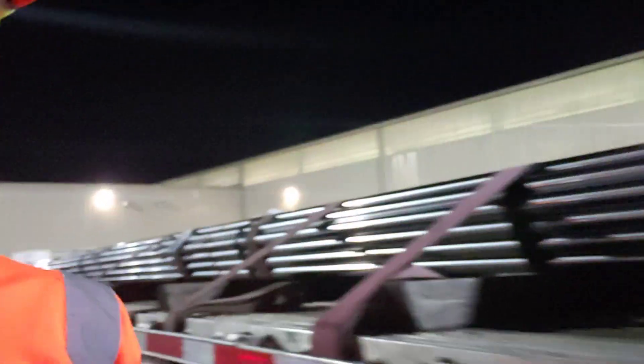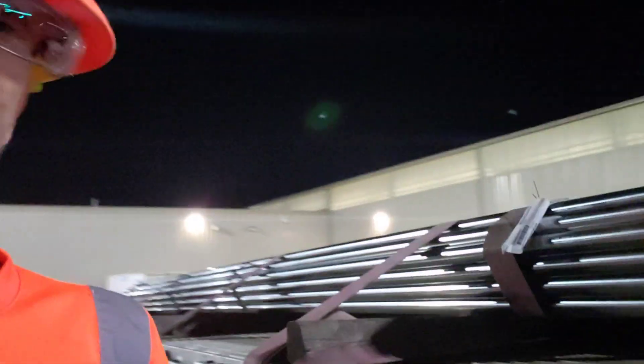Get you a shot from the end. You can see how we've got it secured. One thing to notice is to build this bulkhead up front — this is why I like to carry extra square timbers for building bulkheads that are plenty high enough to cover the top of the shiny bar. You can see we've got straps running down the side. We've actually got two different sections here. You can see in the middle that's where they split. One neat thing we do with these is put a butterfly strap around the front and back of each bundle that wraps around and pulls it to the opposite side. It helps for stability.